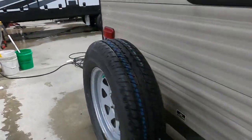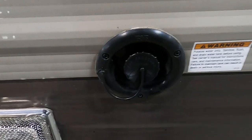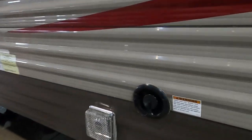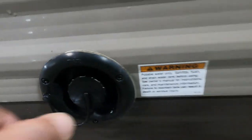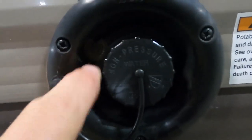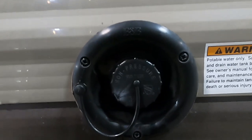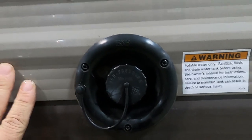Now let's say we're going to go camping and we're not going to use city water — dry camping or boondocking. In that case, we're just going to fill up our fresh water tank. Come back over to the docking station, take that city water connection and move it up to tank fill. Just above your furnace flue there's a potable water fresh water tank. No need for a water pressure regulator here — simply use a hose and gravity fill it. There are two ways to tell when it's full: one, there's an overflow valve; or on the inside where you check the levels of your black and gray tanks, there's an indicator telling you your fresh water is full. Keep an eye on that while you're filling it — don't leave it unattended. Once it's full, put your cap back on. Whenever you want to utilize this water, turn on your water pump. Don't turn on your water pump when hooked up to city water — that is already pressurized.